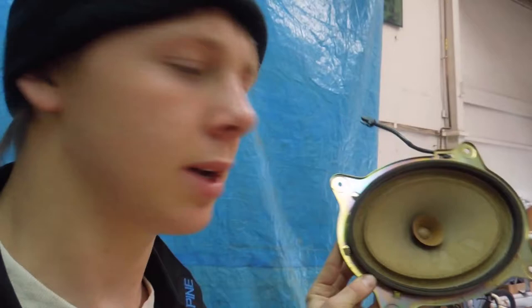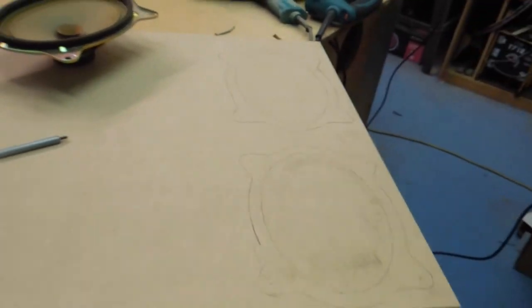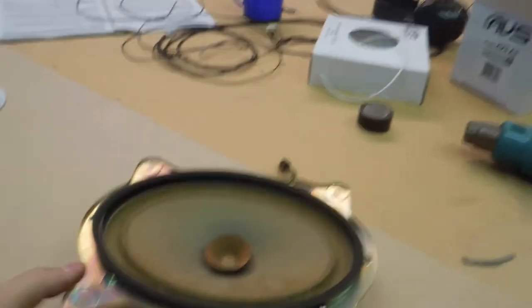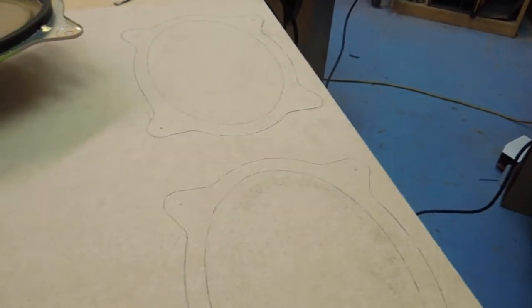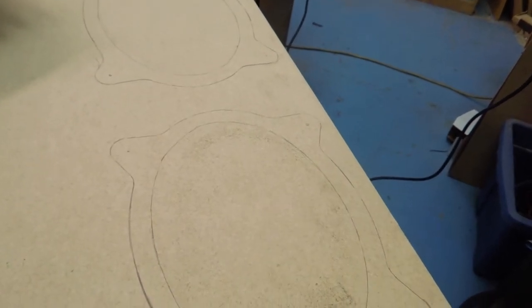Here's my plan. Here's the factory speaker with the big wide bezel on it. This is a cardboard trim ring which comes with the Alpine Type R speaker — you just pop it out of the box and it gives you the inner dimensions of the speaker. I've traced this speaker twice and the inner hole — I'm basically just going to cut these out of this wood and they're going to act as a bezel to hold the speaker in. It's about 6mm MDF. The reason I'm going thin is because there's not going to be much space — these are very shallow speakers depth-wise. Also this is just really a ring designed to get a bit of extra spread on the metal, and it'll all be going through metal so it will be very strong.